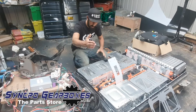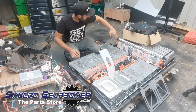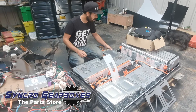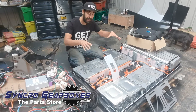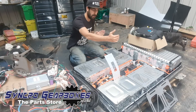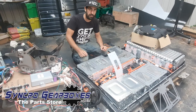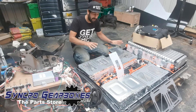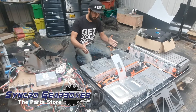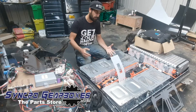This is the front of the battery pack and this is the rear. I like how these modules are stacked — they've got them all up on end like that, stacked neatly, and that's half the pack. So I might end up stacking these to mimic that and having two packs of 24, seeing where I can put them rather than having stuff dotted around. If you really wanted to go to town packaging it so you couldn't see stuff, you could probably package them a few like that somewhere, but then that's more wiring.